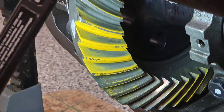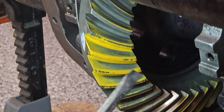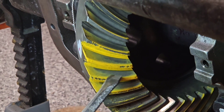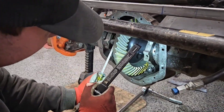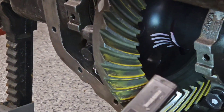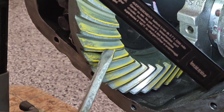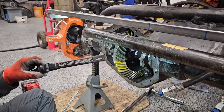Spec is six to ten, but there's the coast side that you should always look at for used gears — never mind the drive side. Maybe just a touch deep, you can tell by the half-moon shape at the end there. But nice even pattern all the way down. If you look at the non-painted teeth, we're not falling off the top of the tooth. You don't want it off the top — all the pattern should be concentrated in the gear tooth. They're gonna break eventually anyway.